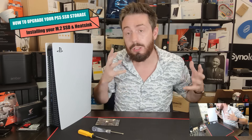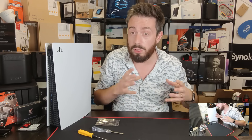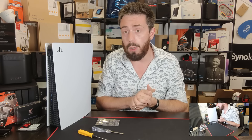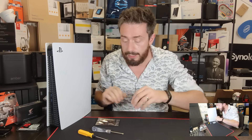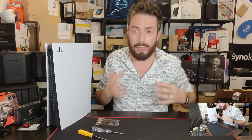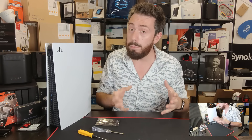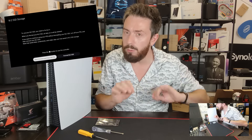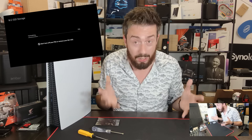Hello and welcome back. Today I want to talk about how to install an SSD inside your new PS5. I already did a video about this last year when the console first came out, but the feature wasn't enabled and now it is. A number of people are wondering how exactly to do it. So in today's video I'm going to be taking the lid off the system, installing the SSD, installing a heatsink as well, and talking a little bit about supported SSDs. We're going to go through the physical installation. It should be mentioned that as soon as you've got the SSD inside the PlayStation, once you reboot it will take care of the rest. The hardware bit some people seem to be finding quite intimidating, even though it's actually quite simple.